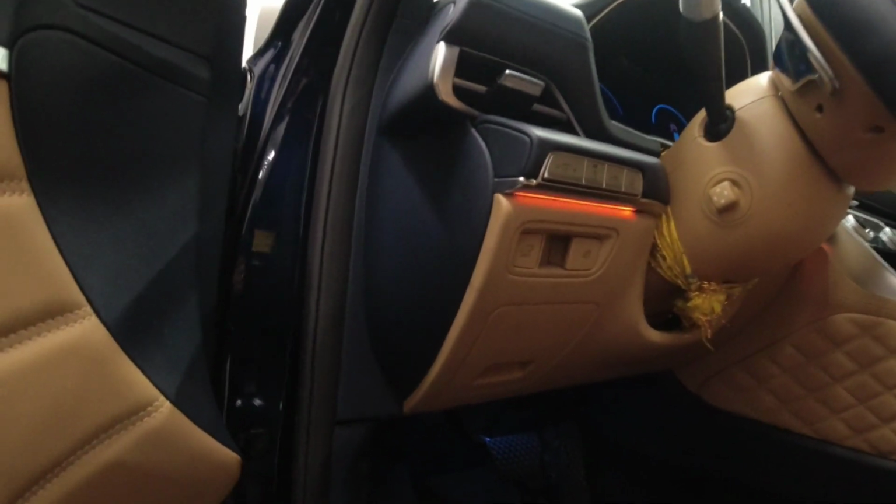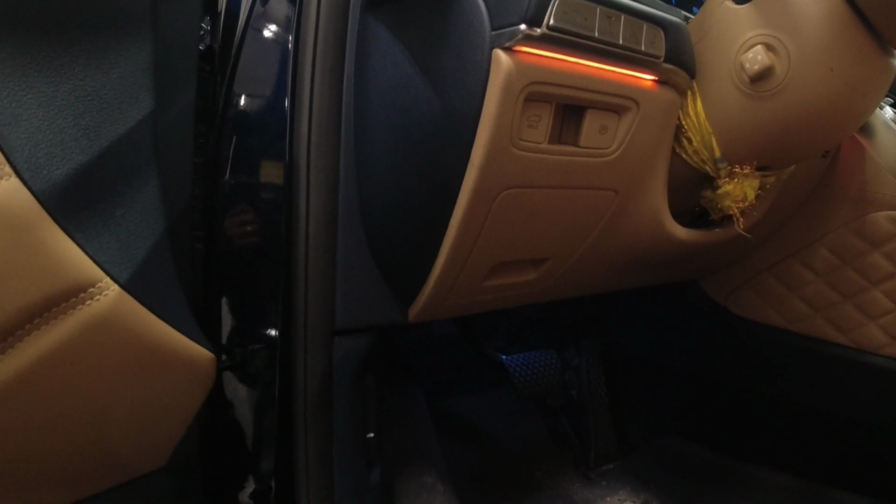I thought it's the brake switch, but I used my stethoscope, you know, the mechanics scope. So I went and touched the mounting for the ABS module and it's still there. So I went under the hood and the noise is coming from the ABS module. Because this is my first time to have this kind of problem, I'm gonna wait for the new module and let's see if after I replace it there's no more noise.